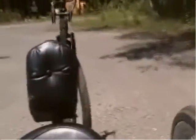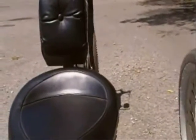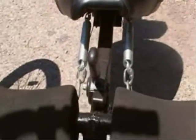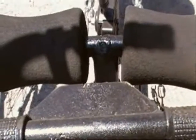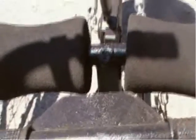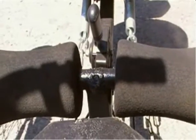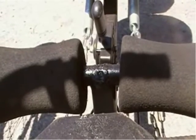The steering is done by your feet — rear wheel steering. The seat slides back and forth, and I do have springs on the cables running to the seat so that you can keep tension on it. These pads back here are where the heels of your feet rest, so you can pull the seat forward if you're on a steep incline. Otherwise this is set up so the back end is a little higher than the front, so you slide forward automatically when you retract your legs.